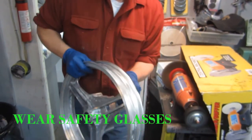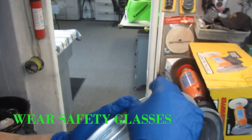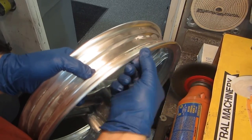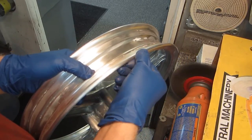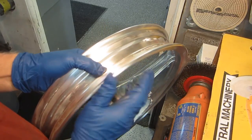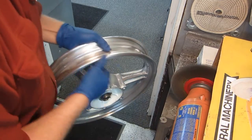I don't want the surface to be shiny in this area here where the tire's going to seal. I want it to be just a little rough so that the primer gets a good bite in there. Now this edge right here — what we're trying to accomplish is to roughen this up. We've already sanded it, just make it a little rougher with the heavy wire wheel, because when we put the tire on — we're going to try to do it without tire wrenches, by hand so that we don't damage the wheel. This is where the paint is going to be under a lot of stress right at that edge.